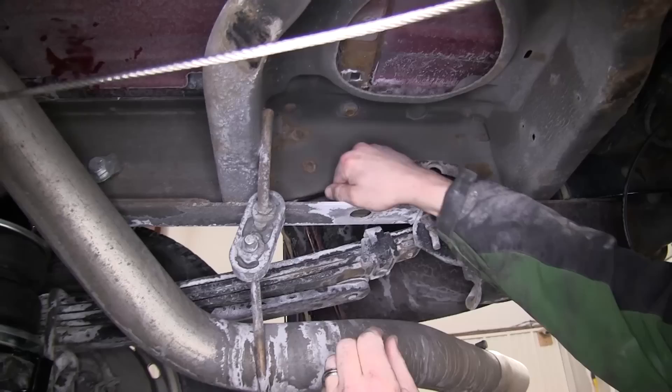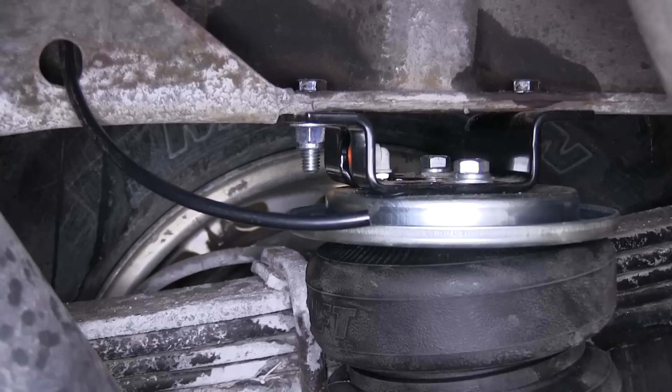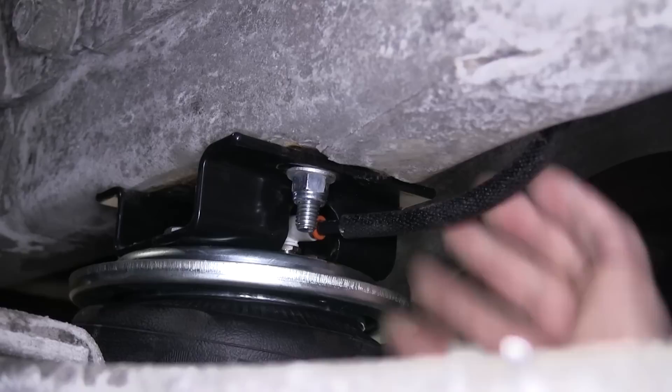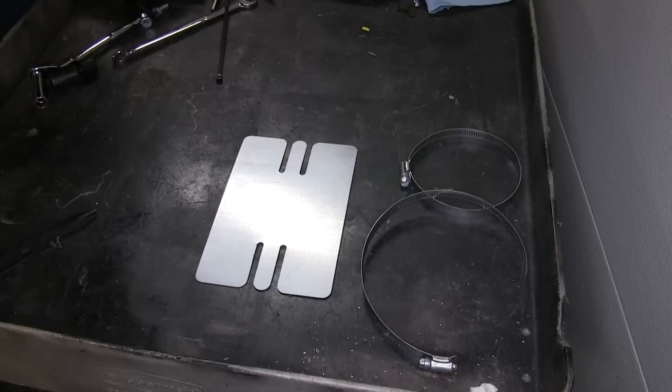Next, we'll repeat the same process with the passenger side. Now, with the passenger side routed over to the airbag, we'll go ahead and cut off any excess length, and then install the airline protector sleeve. The sleeve will fit over the airline and help protect it from any excessive heat from the exhaust. Now, with the protective sleeve installed, we'll go ahead and install the airline into the airbag, pressing it in firmly, and pulling out to lock it in place. Now, we can go ahead and use the black zip ties to secure the airline as necessary. With both airlines installed and secured, we'll go ahead and cut off any excess from the zip ties to clean up our install look.